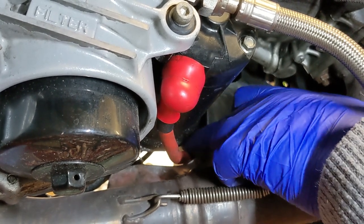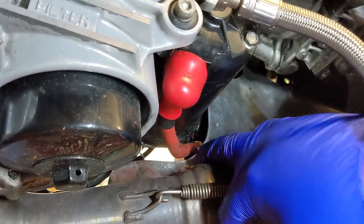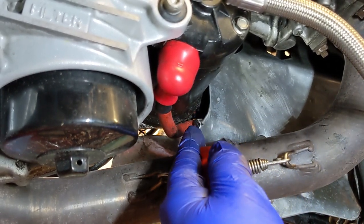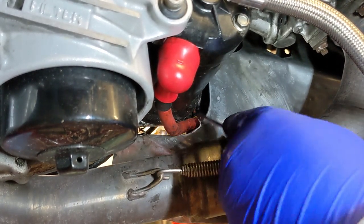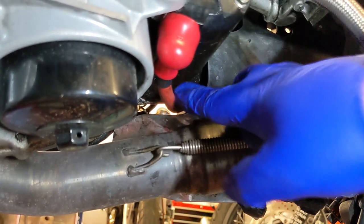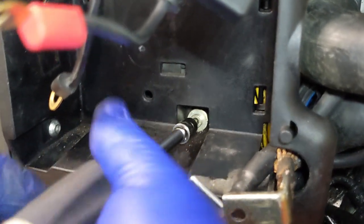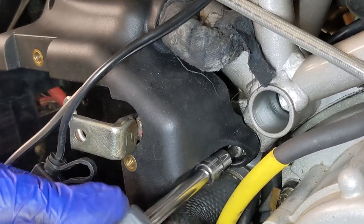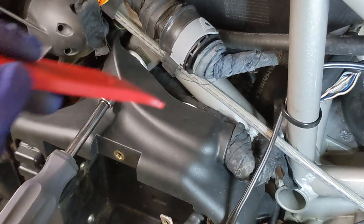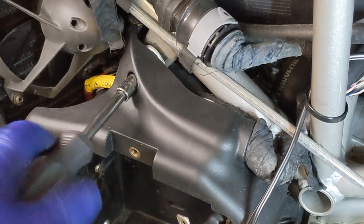I can see there that all I had to do was just push it back into a more suitable place. That is a bit of an edge right there — a little bit of an edge on the heat shield. I'm not going to tell you I like it, because I don't. I just found a sharp edge that I'm not happy with. Luckily the heat shield is pliable, so I'm just moving that tiny little bit away from the go wire. And now when I stick my finger in there, it's no longer sharp. Lovely. So I'm just putting the battery box on the bike. This is the lower 4mm going in, this is the right-hand 5mm, this is the top 5mm. One of the things you've really got to look for is you've got to ensure that the loom itself doesn't get crushed between the heat shield and the chassis — pretty common mistake. Just be careful.